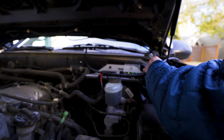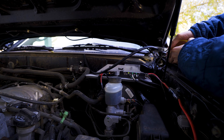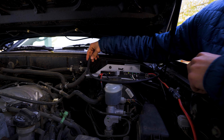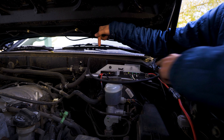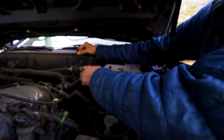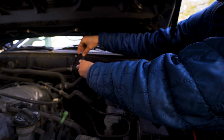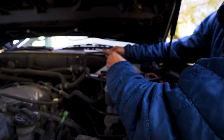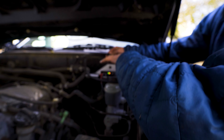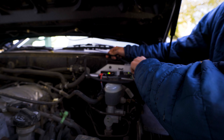Joining these two wires together and running them underneath the fuse box — I'm going to make sure to cut more wire than I think I need. Once we've soldered these together, we're going to have one positive and one negative coming from the driver's side, and one positive and one negative coming from the passenger side. Then we'll join these together and have two wires — one positive and one negative — running to our accessory fuse box. By doing that, we're also connecting all of the lights together so we can control all of the ditch lights with one button.